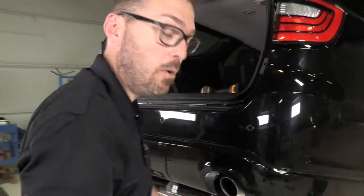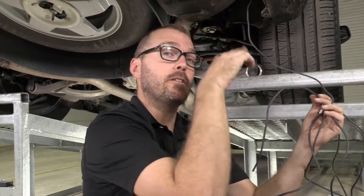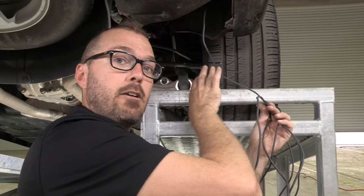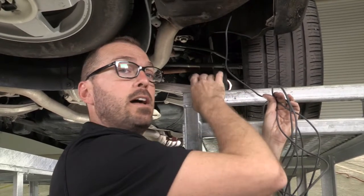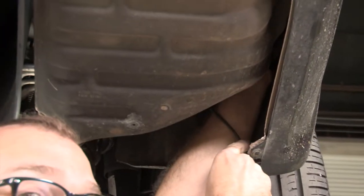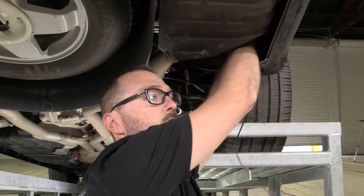Now we'll go underneath the vehicle and route our power wiring. Back under our Durango, I've got the power wire that we fed down the fascia, and I'm going to need to run it all the way up to the front of the vehicle and up the firewall. Your best bet is always going to be identifying and following some factory wiring or line sets. On the Durango, luckily, there's a wire harness as well as fuel lines and brake lines that are running down the passenger side. We're going to simply follow along with how the factory has routed, keeping this wire away from exhaust, suspension components, and obviously away from the driveline — anything that can catch or damage this wire.